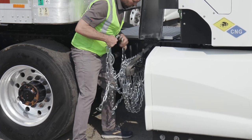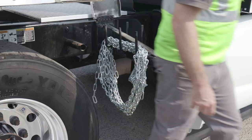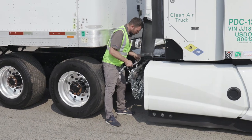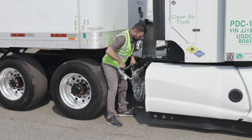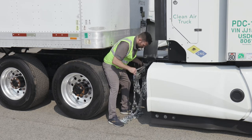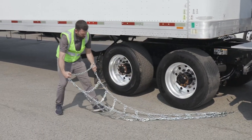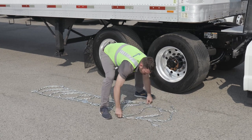The reason to work with the cross chain hooks first is that when you're ready to take the chains off the hanger, you'll be able to just peel them right back — making it much simpler next time. When retrieving chains from stowage, make sure you end up with the cross chain hooks in your hand before you start walking and dragging them out. Unhook and work down to grab that last part with your cross chain hooks, then walk back to get into the installation starting position.